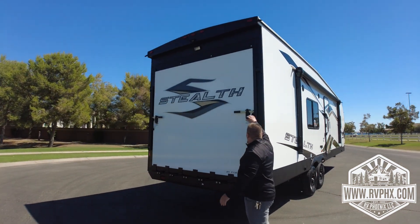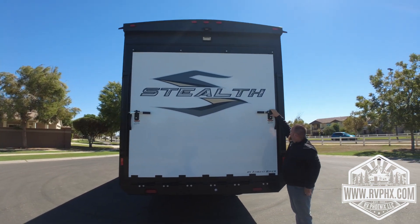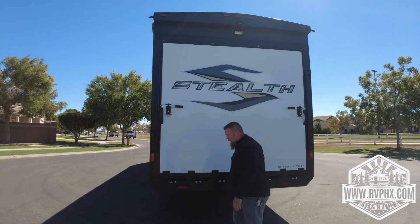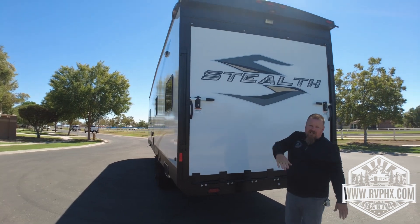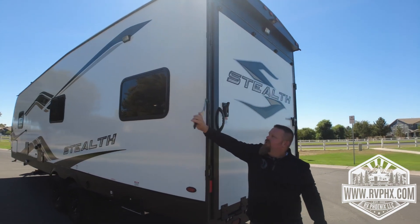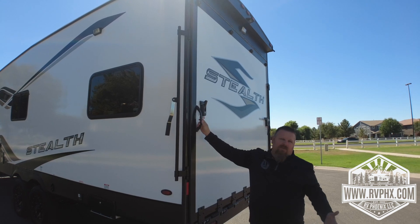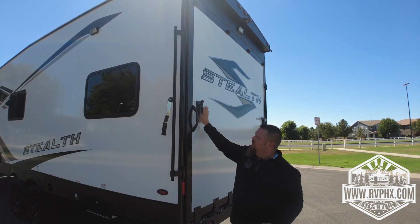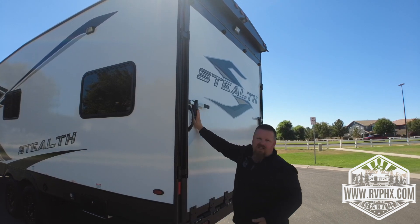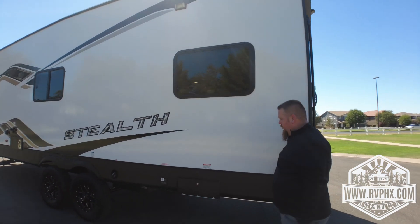At the back is the business area of this unit. You have a rear gate — to access it, push this in and rotate it around, do the same thing on the other side. It's got a big spring, so lower it down softly to the ground and then you can load your toys in. To close it, make sure the latch is completely out of the way, close the door, swing it back around, lock it in, and pull down. You can lock these when traveling.